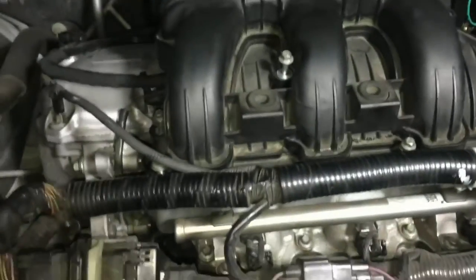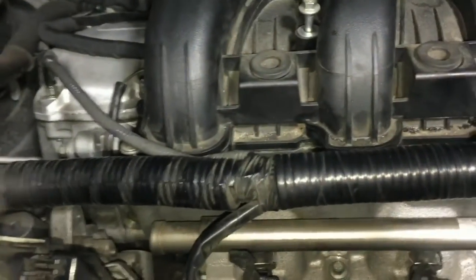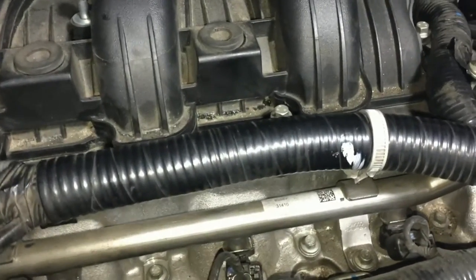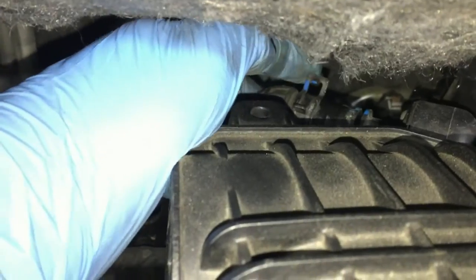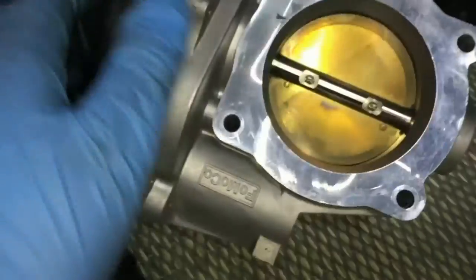With your coils back in place, go ahead and move the throttle body back. There's a certain way you have to torque it — there are two stages. The first stage is at six pounds, following the bolt pattern: one, two, three, four, five, and six. The second pass is the exact same pattern but this time at nine pounds torque. Prior to starting, tighten down the bracket in the back and get your clip back on. Then hook back up your throttle body, which you should have cleaned by now — there's going to be a lot of black around the rim, but that's normal.